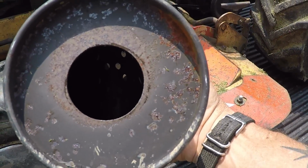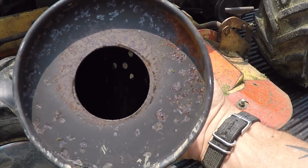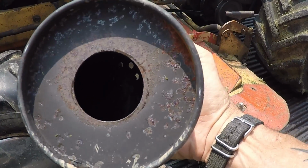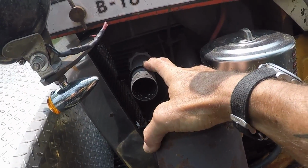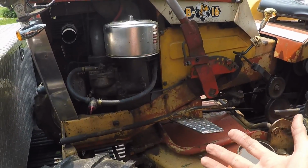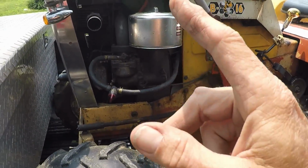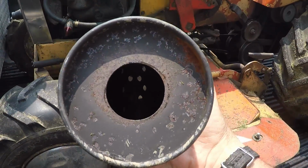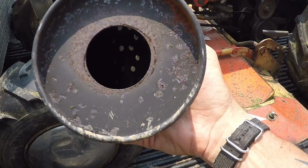If that had been the convex shape that the original Nelsons had, I'm choosing my words carefully, these wouldn't have failed at all, because this would no longer have been a 90-degree angle. It would have been more in the area of, say, maybe a 78-ish degree angle, which is a much more sweeping angle. Also, the stamping should have been relieved a lot more so that it was distributing the load across that inlet face, which it did not do.